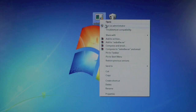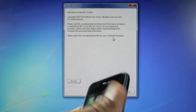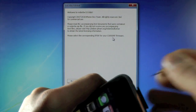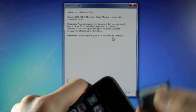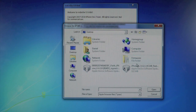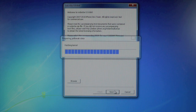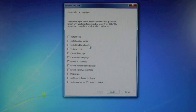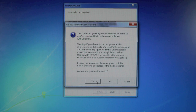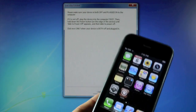On a Windows computer, right-click on RedSn0w and run as administrator, then click Yes. Make sure your iPhone 3G is plugged in, and take out any SIM cards that might be inside — sometimes they interfere with the unlock. Go ahead and browse for your 4.2.1 official firmware. It's going to process it for a moment, then click Next. It'll prepare the jailbreak data, and at the options menu, make sure 'Install Cydia' and 'Install iPad Baseband' are checked. Any other options you want, you can check them. Then click Next and power off your iPhone.